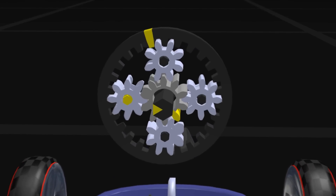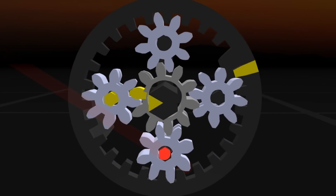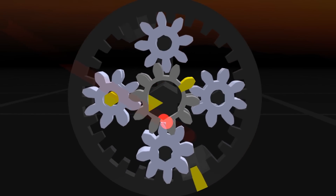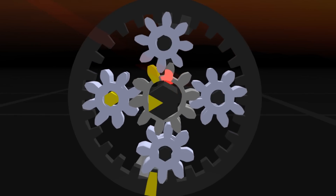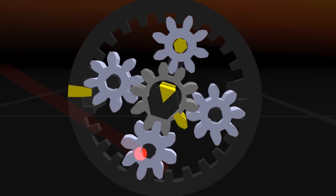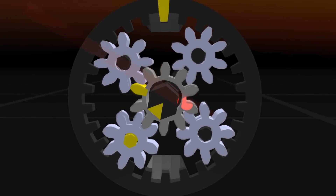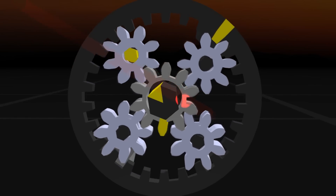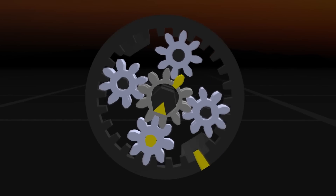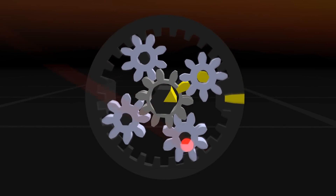Right now the wheels are slowly rolling along, taking the ring gear with them. The engine is stopped, keeping the axles of the planets fixed. Now the sun gear and MG1 have no choice but to roll the other way — freewheeling while the car drives on the battery in MG2. Now if we lock MG1, the planet axles will give way, in effect starting the petrol engine. The petrol engine will rev up, forcing the planets to a higher speed, and taking the sun gear and MG1 with them. MG1 is filling the speed gap between engine and wheels, like a clutch. When the car goes fast enough to connect the engine directly to the wheels, the sun gear can stop. Now all the power can go only one way — to the ring gear, directly driving the wheels.